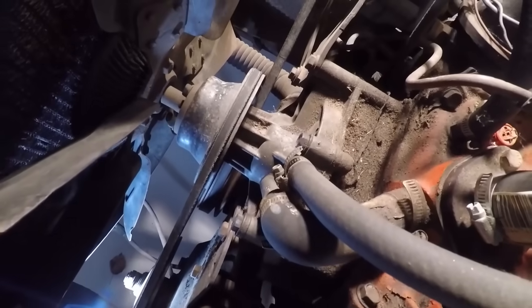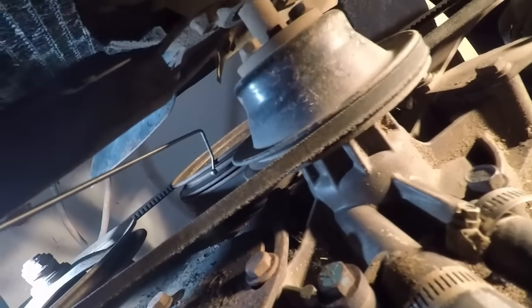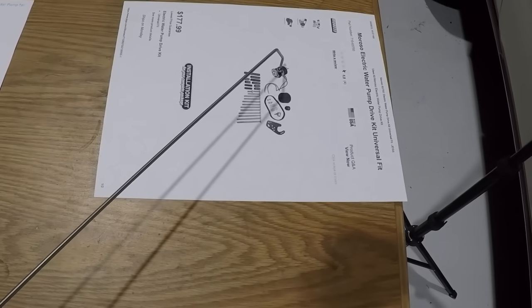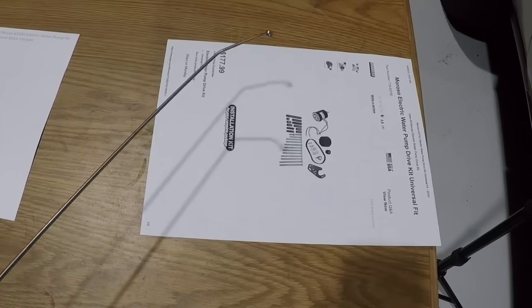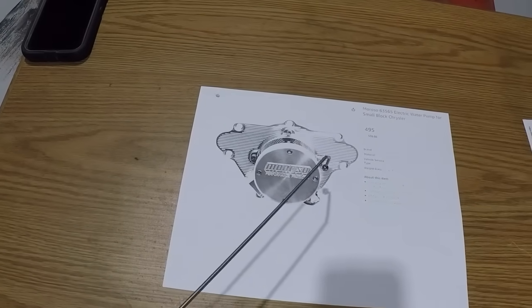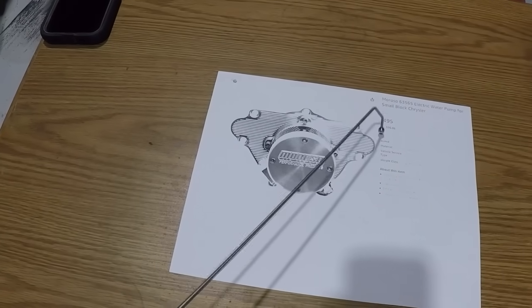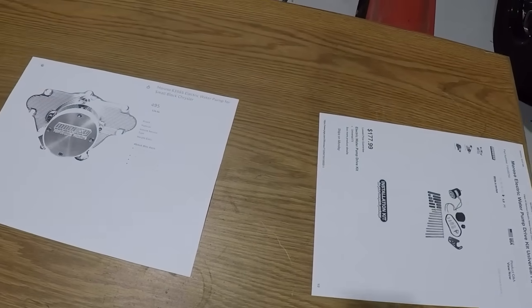So the next thing to gain horsepower is to eliminate this water pump and fan from being driven by the crankshaft. To do that you have to have an electric water pump. Now you have two different choices: you have a belt-driven electric-motored water pump, which means you bolt all this up to your factory water pump and now the water pump is driven electrically instead of by your crankshaft. A couple advantages of doing it this way — number one, it's a whole lot cheaper. Number two, you can bolt a fan back onto your water pump. If you go with a true electric water pump, there's no provision to put a fan on there, so you have to buy two electrical fans, which makes it a lot more expensive. Either one of these will gain you more horsepower without doing anything to the engine itself.